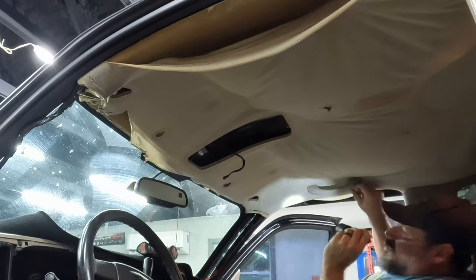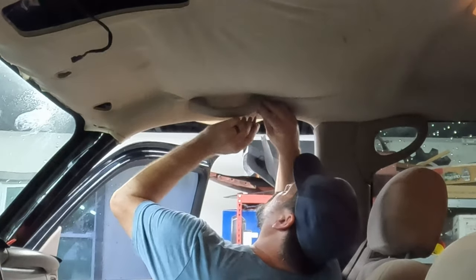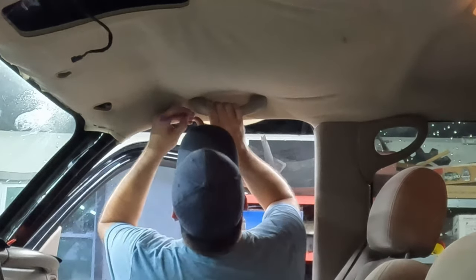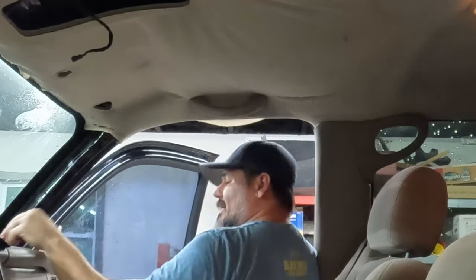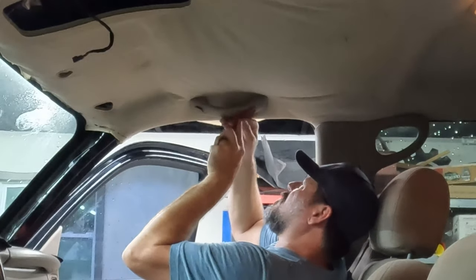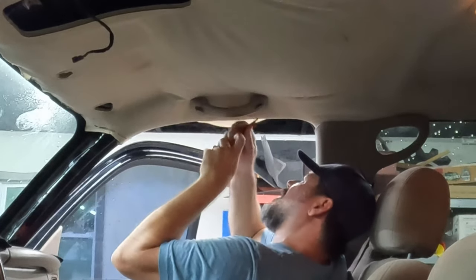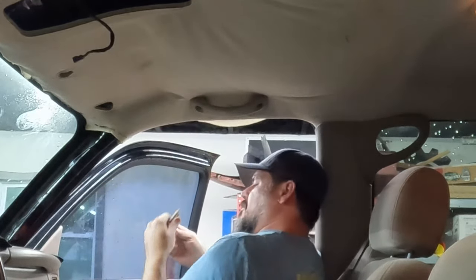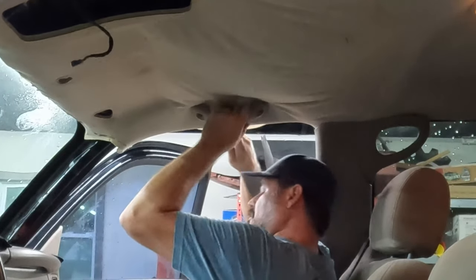Now I'm gonna get this door handle off. See, so this has two pads on it. Let's use a screwdriver tool. I just got a little pick tool here. See if I can pop those loose. And I believe the Firebird was like this too. I think they just pop loose and then there's a clip behind them up inside. So they don't come all the way out. I don't think that one's all the way out yet. So they just look like that. And it should then just come loose. Yep.